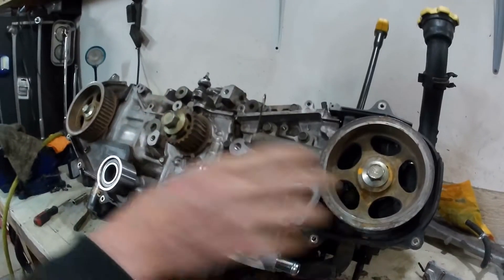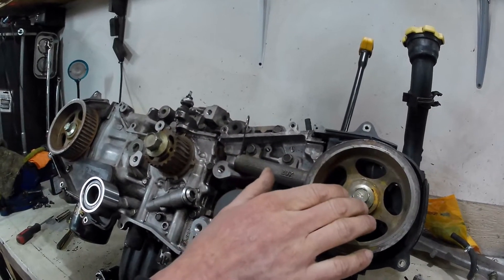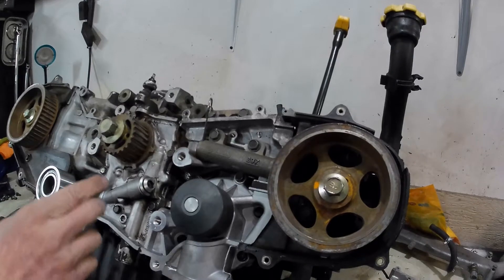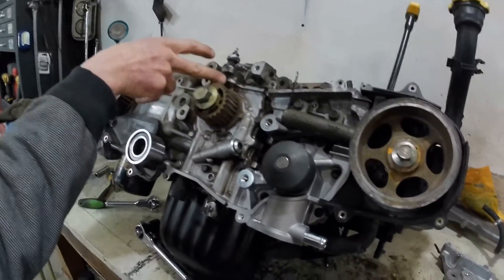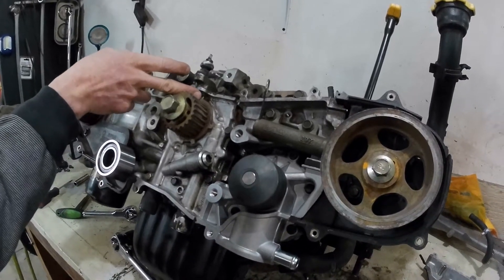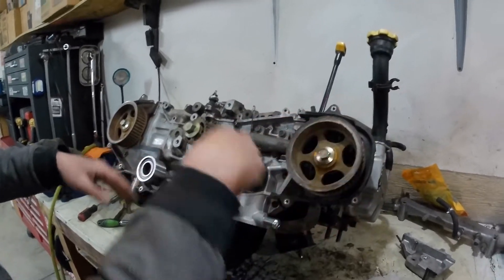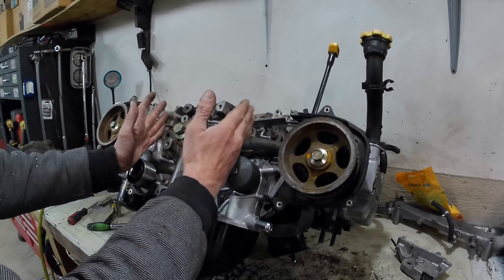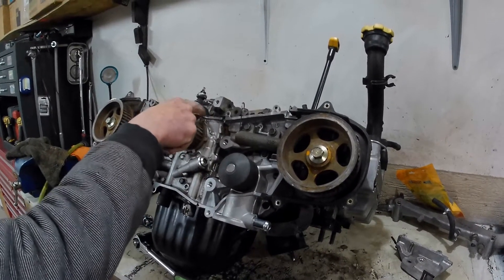The 2.2 like this is non-interference, so you don't ever have to worry about the valves hitting the pistons. But on dual overhead cam cars that can happen, and the same with the newer single overhead cams — the valves can hit the pistons. One thing to always remember is that if you have the crank in this 12 o'clock position lined up with that little mark, all the pistons are at about the halfway point in the cylinders, so they're all going to be far away from the valves. So if the belt slips or you spin it backwards, you don't have to worry about valve-piston contact — they'll all be pulled about halfway in the cylinders.